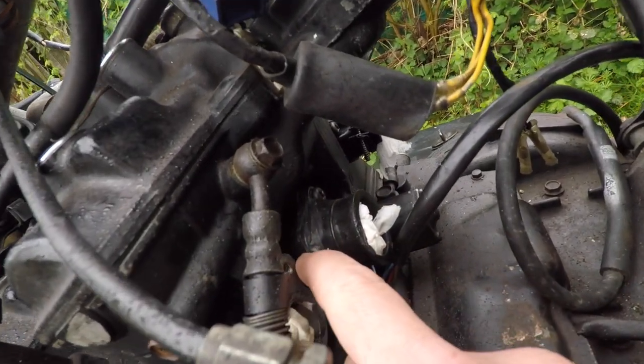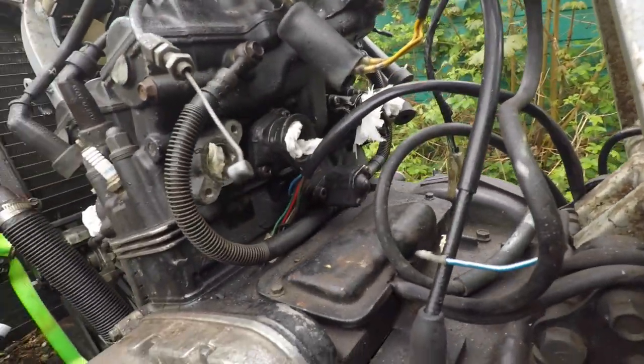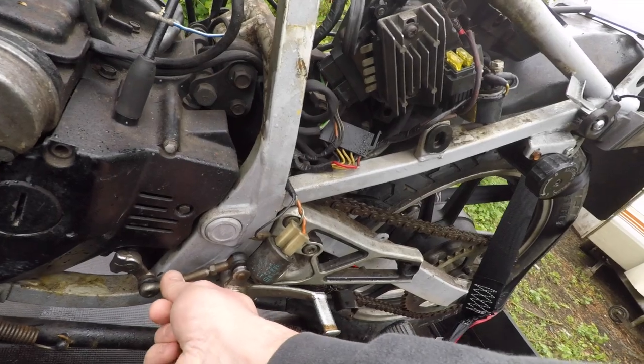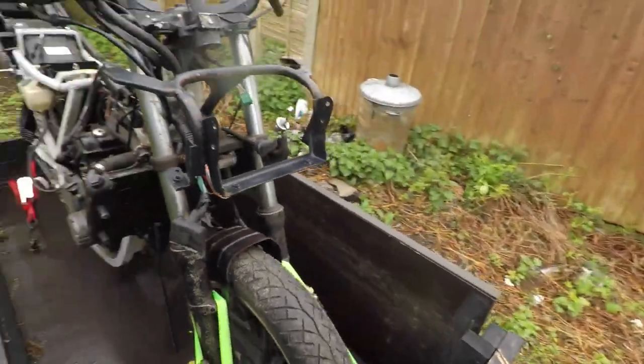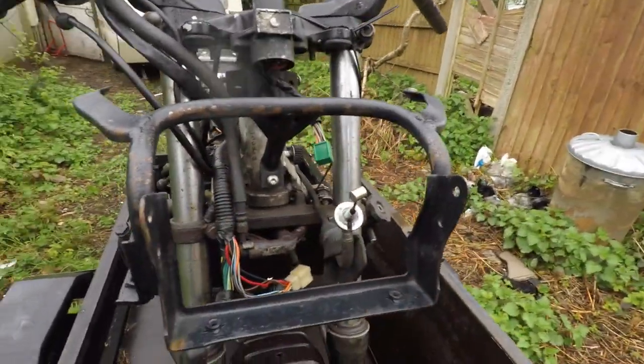The guy had the same issue because there's some silicon here. There's no rust on this — it's sick. These are in good nick, they've been cleaned. What I'm planning to do is use this engine as-is after I clean it, and use my pistons and parts from my engine because my engine has run lower mileage — only 11,000 kilometres versus this one's 20 to 25,000. I'll keep my spare parts as spare parts.